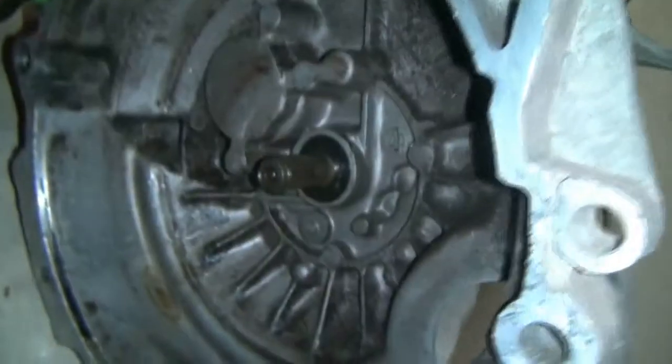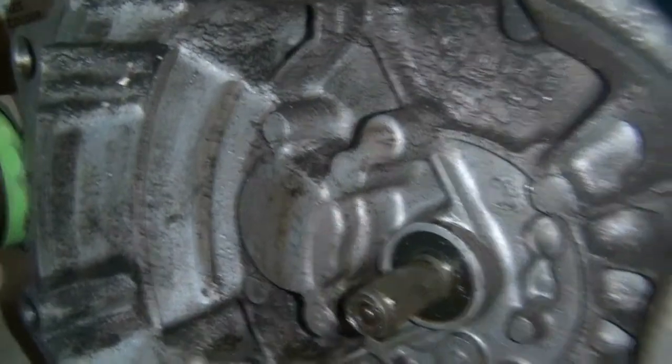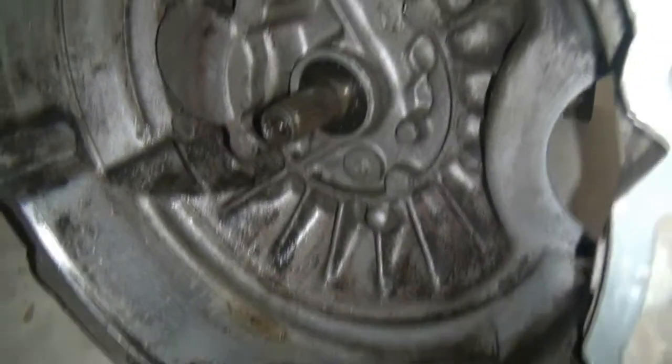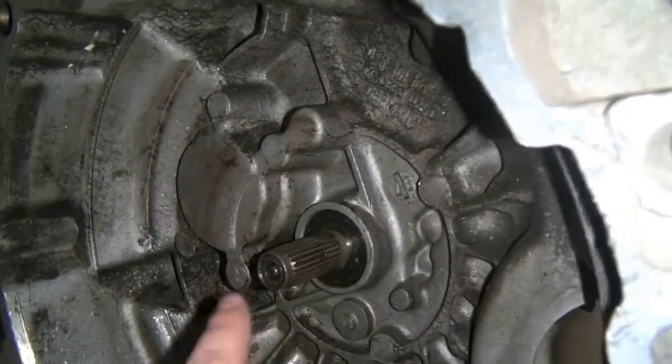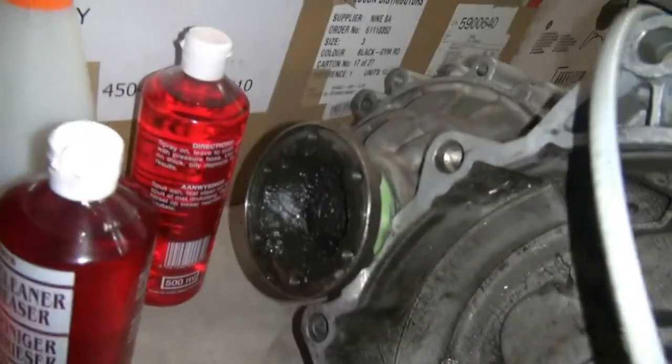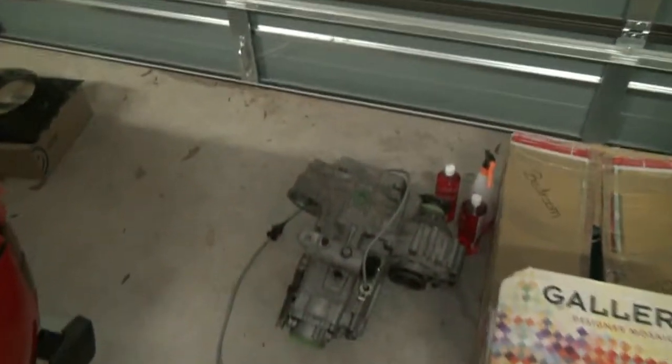The other thing I had to do - when I cleaned out the bell housing I doused the push rod and everything with some Q20 just to stop any surface rust from forming. You see this is still dirty, but I'm not going to waste too much time in the bell housing because once the clutch and everything is installed you're never going to see this again. I nuked this whole thing with Q20 just to keep it oiled and protected. I started to clean out the diff cups and things where the CVs go on - I've got new grease so I'm not too worried about that.